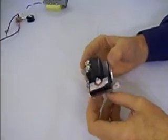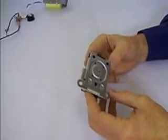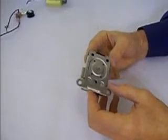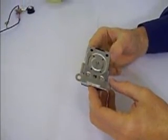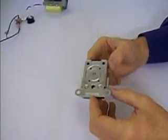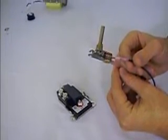That's just too much for an egg incubator. There are some tricks you can try to improve that, but unless you want to do a lot of tweaking and trial and error, this one can be problematic. There are people who have had success with it, but you've got to be willing to try a few tricks to make it work well. For only a few dollars more, you can use the bimetal thermostat, have better results, and it doesn't take as much tweaking.